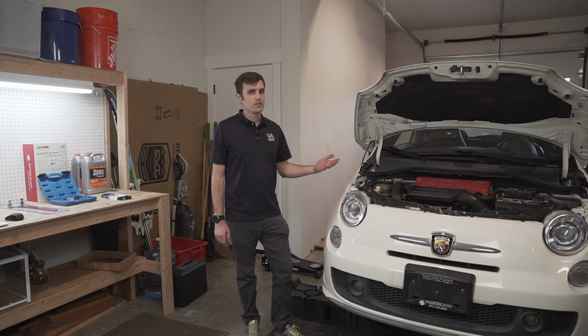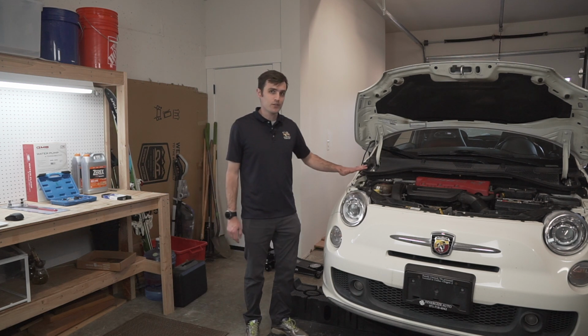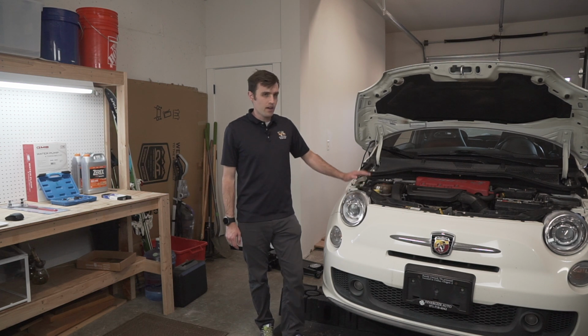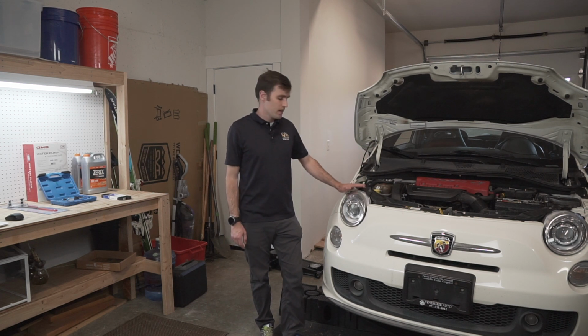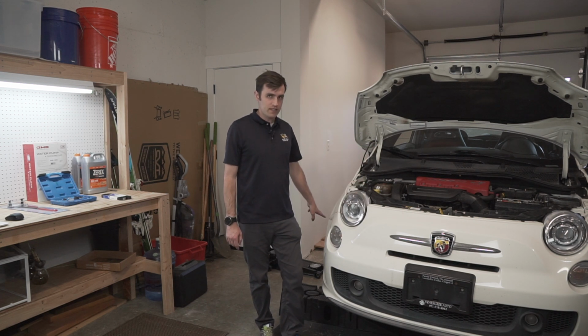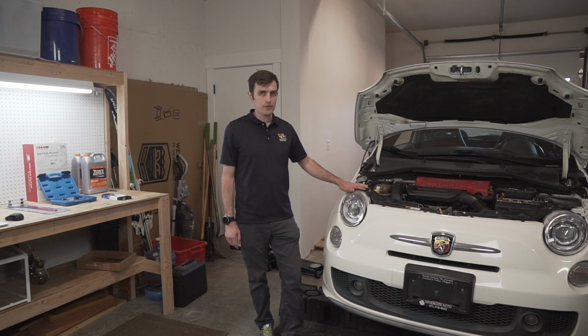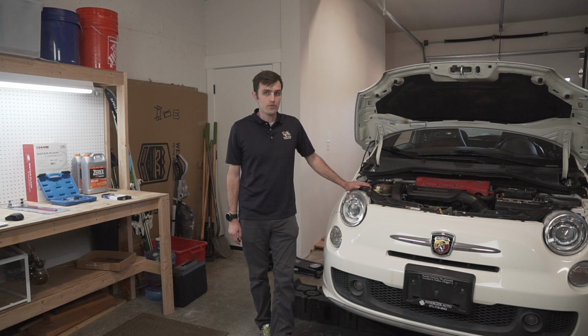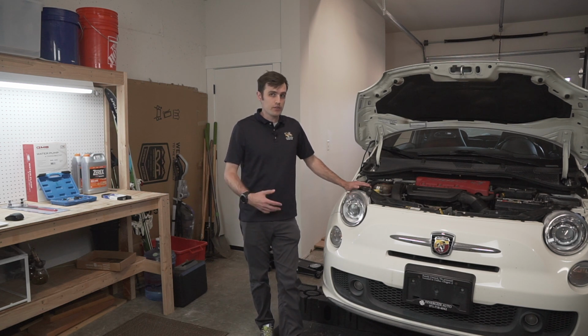Anytime you're working on a car, it's really important to make sure you don't crush yourself. That happens to people, and it's kind of dangerous. So I've got 3 wheels on ramps, 2 jack stands over here, and I've got this under it for safety until we take the wheel off. I'll have to get under the car to drain the coolant, take off the under tray, and do a few things before we take the wheel off, so that's why that's there.